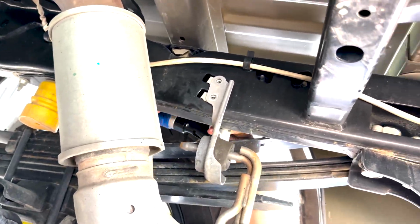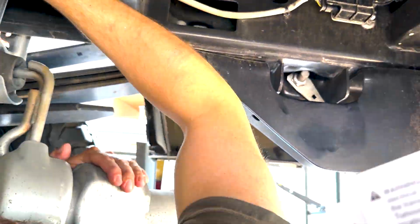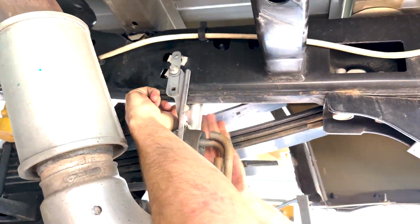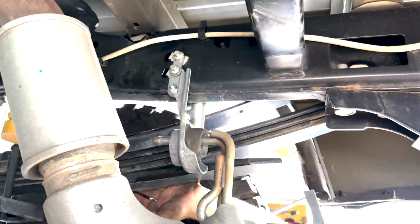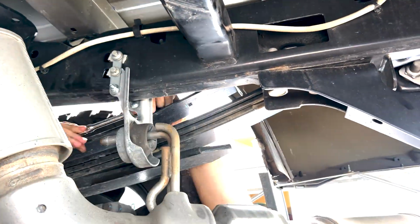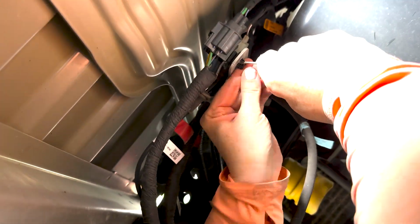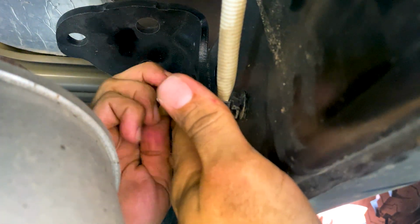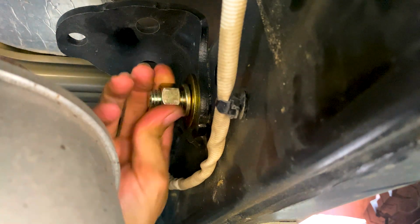The first thing to do in this case will be reposition the exhaust down to make room for the cross members of the hitch assembly itself. Usually with the OEM setup, the exhaust retains its stock position, but to install the OEM hitch after the truck has been built would require the removal of the bed, and that's just not an option in this case. And then the final setup step here is to relocate some of the wiring to make room for the bracket itself. This option is made for the DIY person to do after the fact, and its install and setup go together fairly easily.